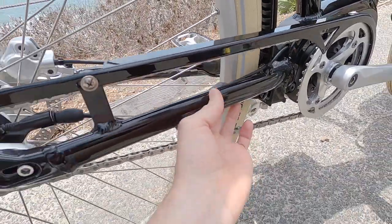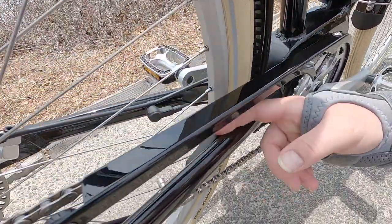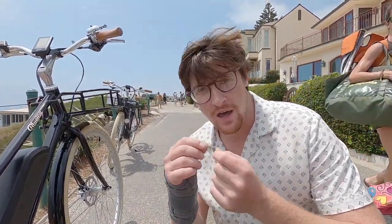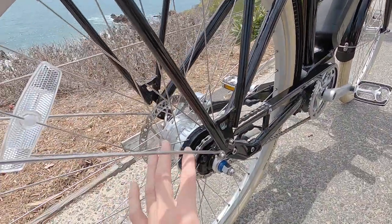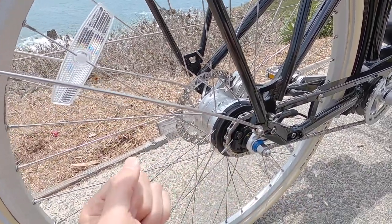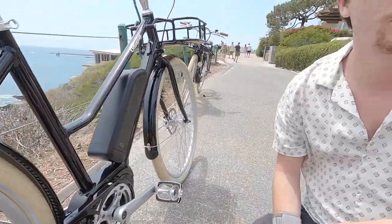So Mark, what is this little box right here? This is an inline shift sensor. It feeds off of the actual shifting — the mechanical cable goes through there and it has a little strain gauge that measures that minute shifting action. Because with such a powerful mid drive, when we're shifting through those gears, even though this internally geared hub is pretty sturdy and it can be shifted at standstill, you still don't want to put undue strain on it with the big motor. Internally geared hubs — the shift gates — you don't want to shift under load. And so this is automatically pulling power for you.